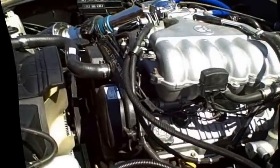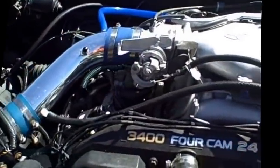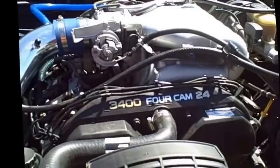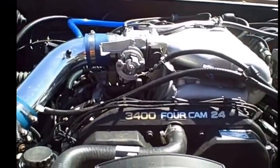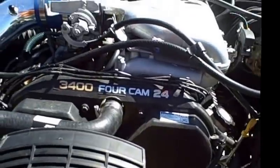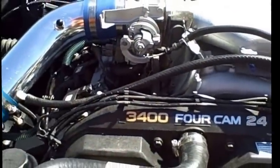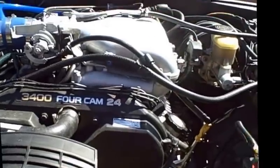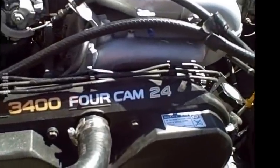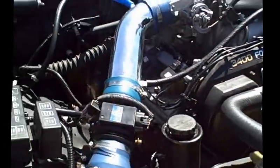It should keep it clean, and most importantly, this little preventative maintenance before you put it in is going to save you a lot of codes. Of course, I didn't have that many. One code I got was a throttle position sensor, but most importantly with my engine, and the frustration I had, is it simply would not idle at all. It was starving for air, and my mixture got mixed up and the whole nine yards. So for those people out there that decide just to suck it in and clean it that way, keep in mind that little tube at the bottom.